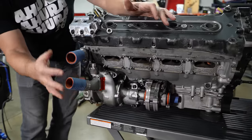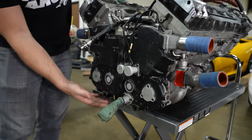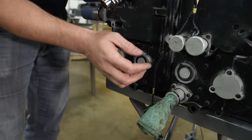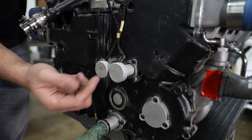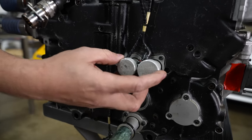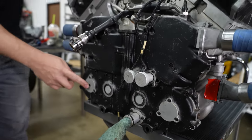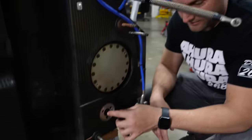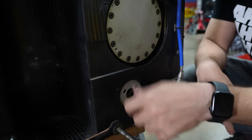We've got coolant in and out on both sides. We've got oil here — it's a dry sump, meaning there is no oil underneath the motor. It's pulling a vacuum, which on a piston engine is a very beneficial thing and increases performance. There's an air outlet and oil outlet, which means there's some sort of separator. This is really deceiving — out of this comes a little quill hex-shaped thing with two little wings on it. Those wings, when the motor is bolted back up to here, match up with two hooks on this end, and there is a mechanical pump supposed to be inside of there.